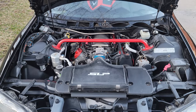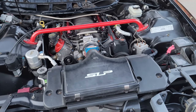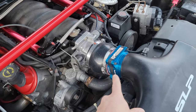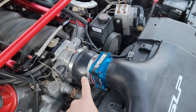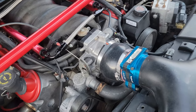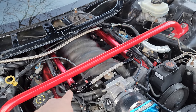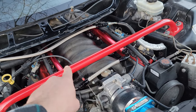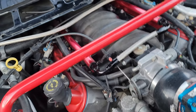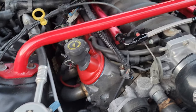Let's move on under the hood. Starting at the front, we got rid of the stock intake and put in the factory SLP cold air intake. We added a VMS mass airflow sensor, the smooth bellows, and the throttle body I pulled off and port and polished as much as possible. These fuel rails came thrown in with the deal — we've connected them and ran our lines all through here. We got rid of the 26 pound injectors and put in 31 pound injectors.